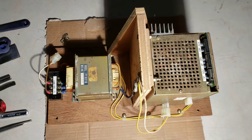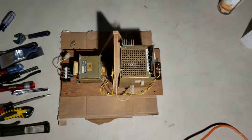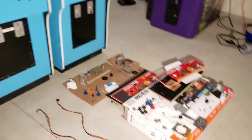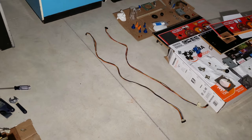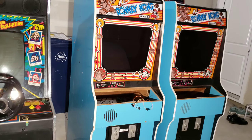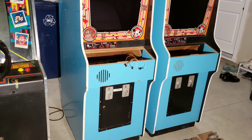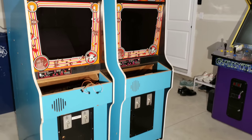We'll work on that tomorrow or the next day as we get time. Next thing we're going to do is get the stuff from Mike's Arcade - supposed to show up Tuesday. Get the control panels all reassembled. A couple of wire harnesses I pulled out and washed - those were particularly filthy. We're going to get these control panels hooked back up, do a few maintenance items, and then move on to the monitor cap kits and the audio amps. The one on the right has a particularly loud hum that I want to fix.